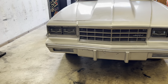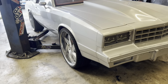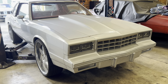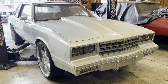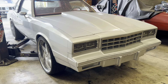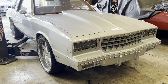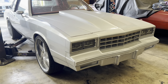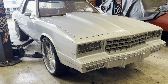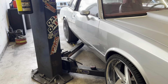The alignment is done. I just got to jam the inner and outer tie rod sleeves with the two crescent wrenches — adjustable wrench style. Front frame notch done. I still have to put some grease on some areas in the front — ball joints, control arms — I'll grease it all at one time. The back arms could use some grease too.